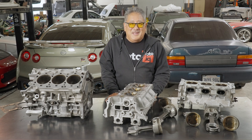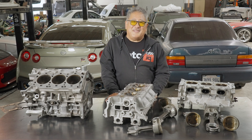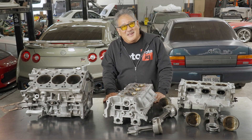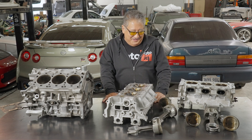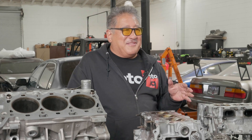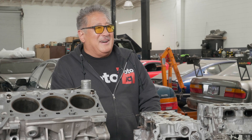That's one of the reasons why when you get a new motor you should always have a reputable tuner check out and set your running parameters. Your tuner can determine how much boost is safe for the octane of the fuel you plan to run and can tell if you're running out of pump or injector capacity. Another cause of running too much boost — especially if you just had your engine in and out — is maybe the wastegate lines weren't connected correctly and you have leaks in the lines going to your wastegate, which would cause you to run a higher than normal boost pressure. These are all things that have to be considered.